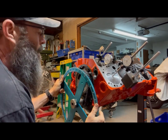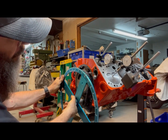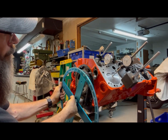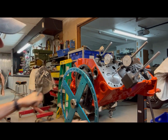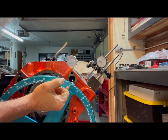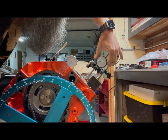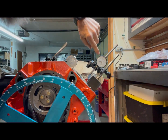I'm going to loosen the crank nut here and lock this down to zero. Perfect. Now that I've got everything set up and locked in, I've got absolute top dead center. I'll zero this dial indicator here.